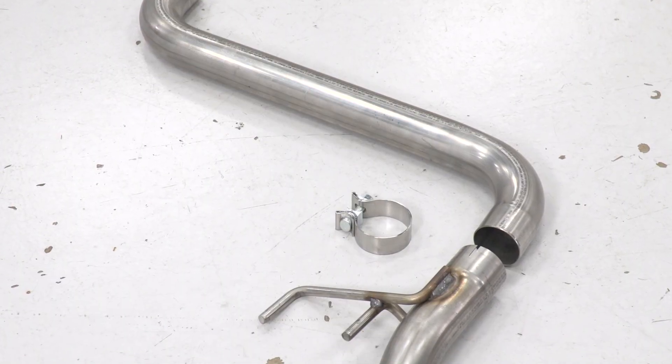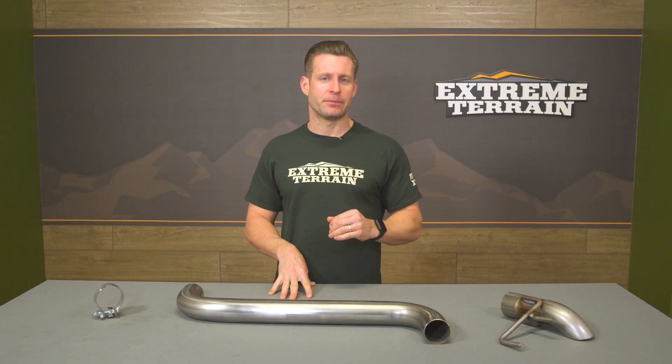This particular option features their high-clearance turndown tip, which is my personal favorite of the group from MRT. They also offer a King of the Hill system with a larger 3.5-inch tip, and they also have a dual-tip option as well. The high-clearance turndown is going to give you the most clearance — so if you do a good bit of off-roading and want to maintain great clearance and departure angle without worrying about scratching up your expensive tip, the turndown is certainly the way to roll.